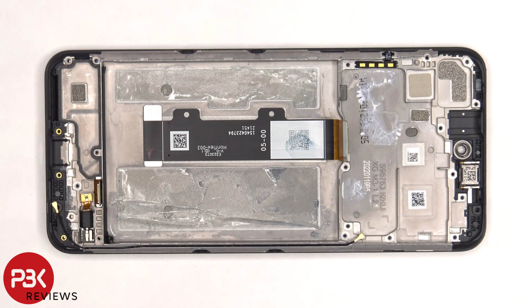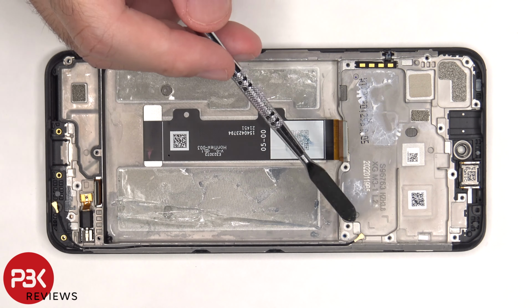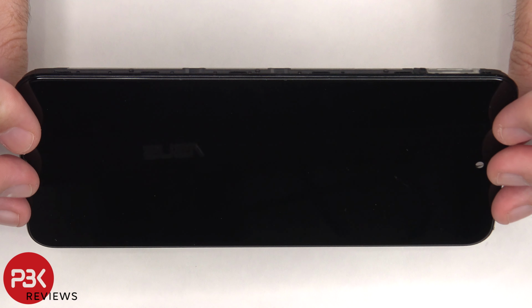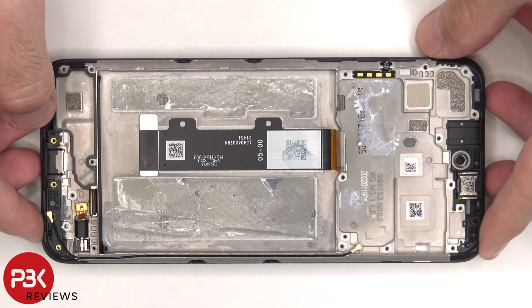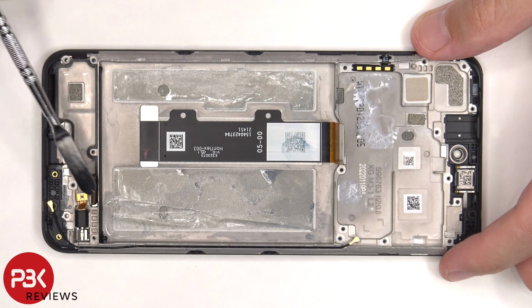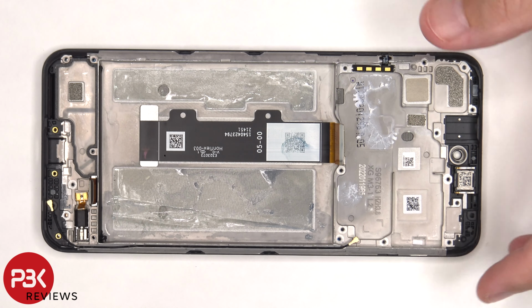Now that the battery is removed, we can see this flex cable which is right through an opening in the mid-frame, which connects the subboard from down here, as well as the screen to the main board. So if you needed to replace the screen, you'd have to remove the back housing, and then you need to remove the screws on the top and bottom cover and remove those covers. You'd have to disconnect the battery cable as well as this flex cable from the main board. Then you need to pry the battery off, as well as disconnect the cables from the bottom subboard and remove that subboard. And then you'd heat up the front of the phone where the screen is to loosen up the adhesive underneath, pry your old screen off, apply new adhesive, reapply your new screen, making sure you run both of these flex cables through the openings in the mid-frame, and reassemble your phone.